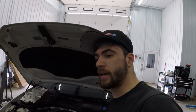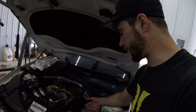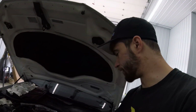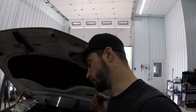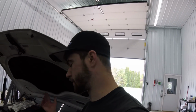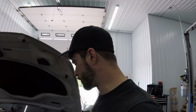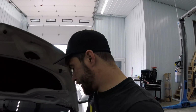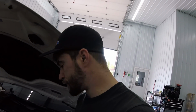Like I said, I did kind of do it the difficult way, rather than draining the coolant out of the overflow tank, getting rid of that, and getting some of these hoses and stuff out of the way to where I could really lay the harness back. I just went ahead and worked around it. You can do that. I'd rather work around stuff than take everything apart. It kind of depends how you want to do it, but it is possible to do it without draining any coolant, without opening your cooling system up. Just a little bit more difficult. You got to take your time. You want to make sure you don't put any stress on any wiring harness or any connector and end up breaking something.